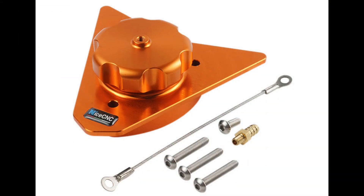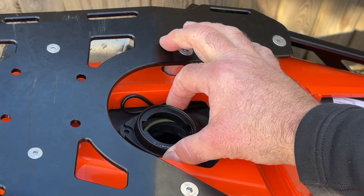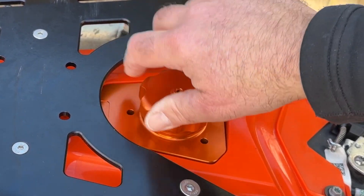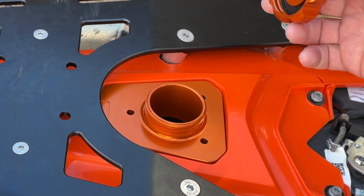So this is the new kit. Let's get it on the bike. Key in, remove the old petrol cap. I've already undone the bolts and taken the breather hose off. Pop the new one in and as you can see it's a slightly better fit — you take the cap off and there's less chance of stuff falling in, which is why we've done it.